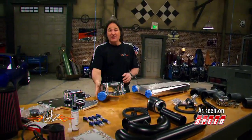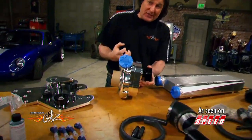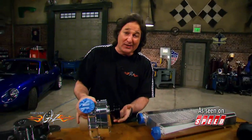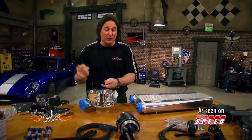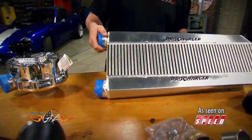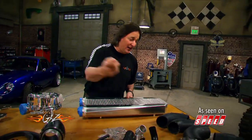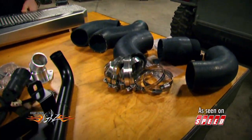The way this works basically is your supercharger compresses air to give you a more dense blast of air. The problem is when it compresses it, it gets hot. So ProCharger runs it through an intercooler, which cools the air down, so you've got a nice, big, dense blast of air that runs through the hoses into the engine.